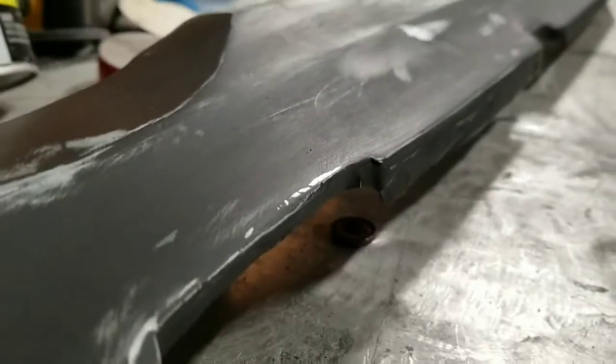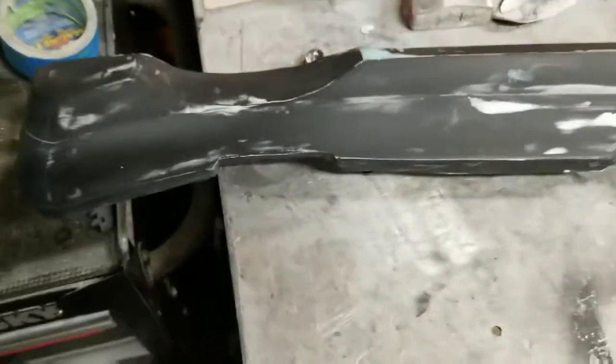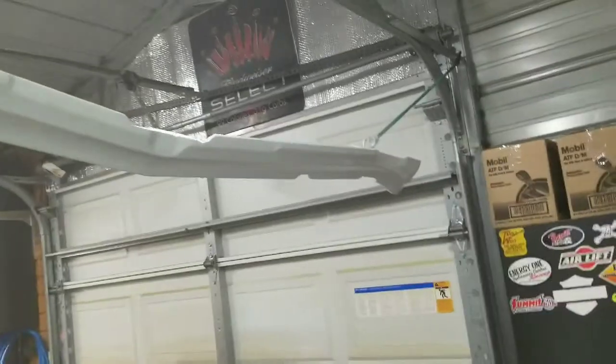See how the bumper filler turned out - you can see where I masked those lines off. Nice and straight. I just got done wet sanding it with some 400 grit; had a little nick right here I had to fix but I'm gonna hit that with some self-etching primer and shoot some white on it - get it on the Falcon tomorrow. Got the bumper filler all painted up. If you guys have any more questions about how I did the AC delete on the box, just comment and ask - I'll be more than glad to answer. Like, subscribe, comment - peace out y'all.